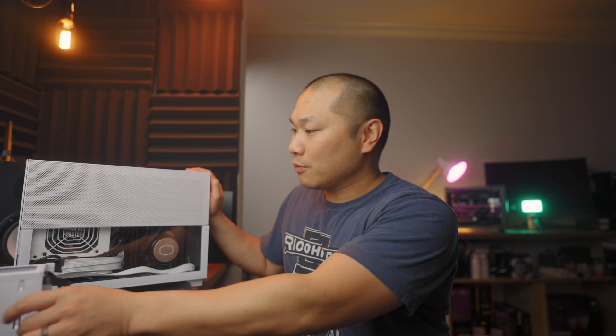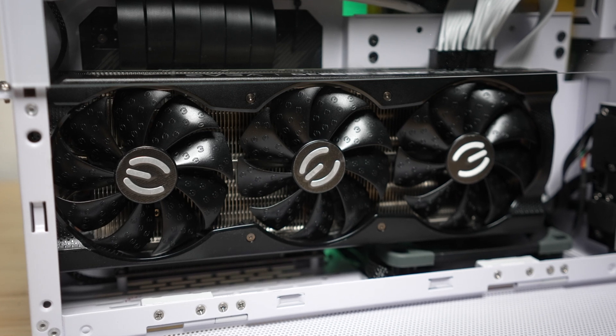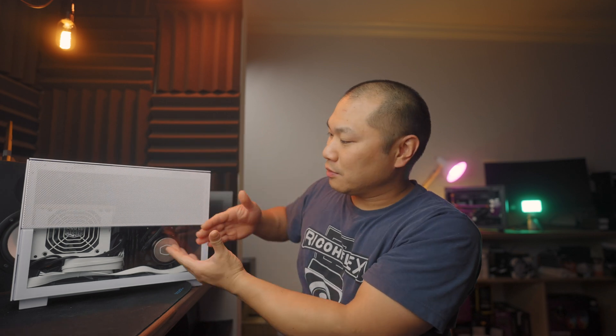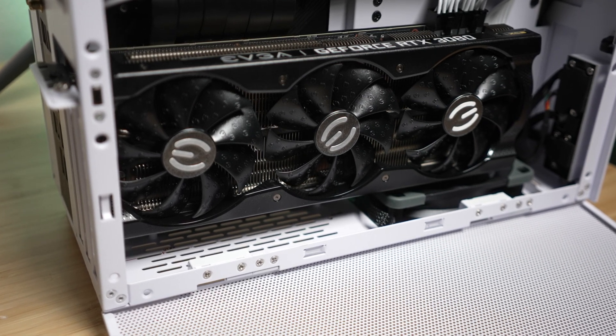This is how it's set up: I vented the area immediately in front of the GPU and also the top motherboard side, and you can see it is a diagonal setup with glass on one side and on the top half of the other side. The rationale is to vent the GPU, and instead of creating a makeup air path that involves using the GPU's exhaust, we create a channel of cool air intake for the radiator so that the radiator fans can avoid taking in that GPU exhaust.